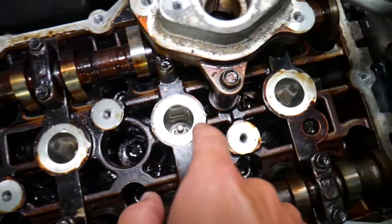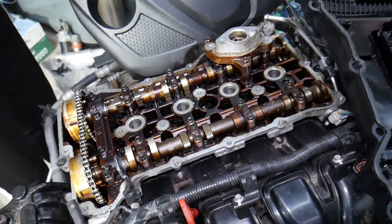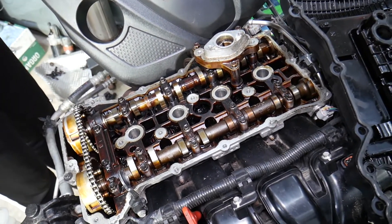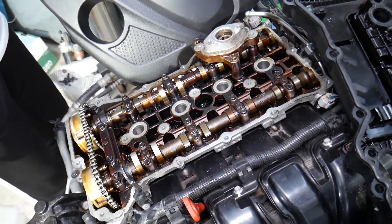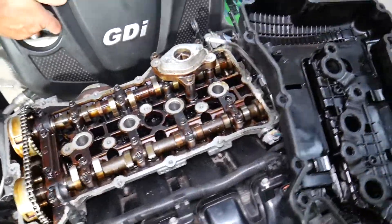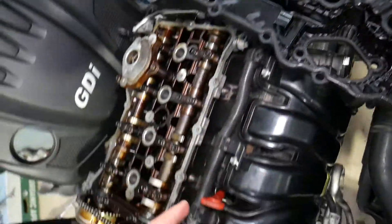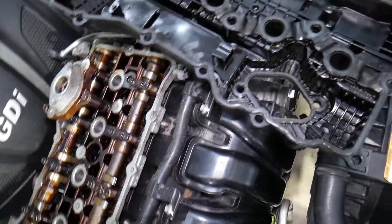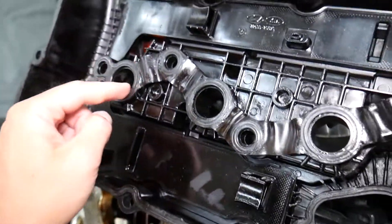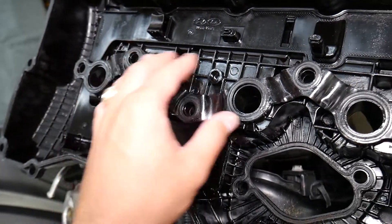If you remove your spark plug or ignition coil and that hole is full of engine oil, that is actually something fairly normal to expect on an older engine, but it needs to be fixed as soon as possible because you can lose power, the engine can die from misfires, and you could get in an accident. What causes this? It's usually only one thing — a failing valve cover gasket. In the past, the gasket only sealed the outside, but now with dual overhead cam engines, where two camshafts sit right in the middle, the spark plugs are centered, so the valve cover gasket also includes a spark plug tube seal.